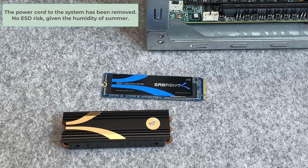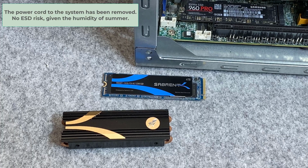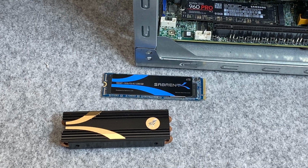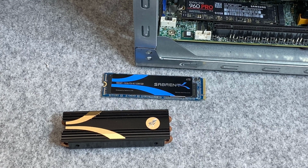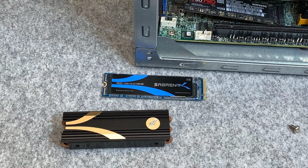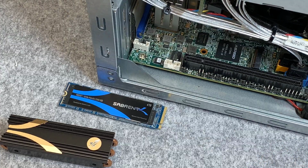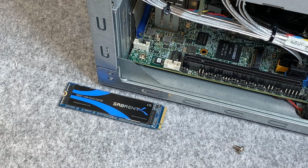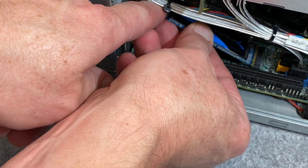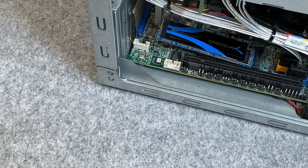First thing to do to get this installed will be to back off the tightness of this screw here and lift it out entirely, actually. And this is a very lightly magnetized tip here on this screwdriver. That's nice and long and goes straight in from the top on this Bundle 2 Super Server. This is the mini tower. Supermicro chassis here. So now that we got that ready to pop out, and we've got the set screw right nearby, I'm going to go ahead and install this Sabrent 4 terabytes in this Supermicro 5028D-TN4T motherboard here. This is the mini tower, bundle 2 from Wired Zone we're looking at.